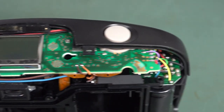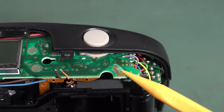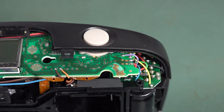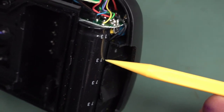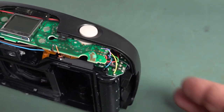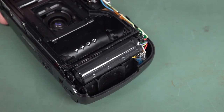Ta-da, we're in! It's not much there. There are those contacts for the zoom — it's not resistive or anything, it's just like a digital button: is the zoom off in the middle, is it going that direction or this direction? And there is the no-touchy part until you've discharged this — that's the flash capacitor. They take up a lot of room. I don't know why they still have flashes in modern cameras. Even modern digital compact ones take up half the room in the camera. It's crazy.